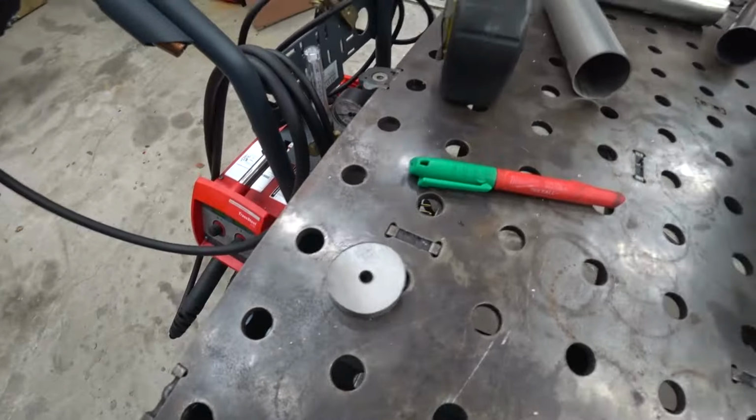We should be good if we modify that heat shield. Yeah, if we modify that heat shield, we should have room to cut through here. It's going to be tight with 4-inch, but definitely need to keep the wastegate tube all the way over this way. I'll probably cut it and 90 it there. We'll worry about that once we get this stuff welded.